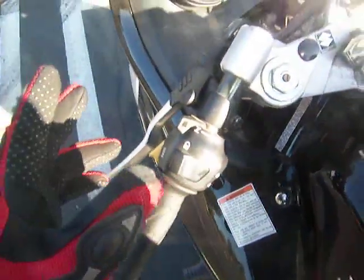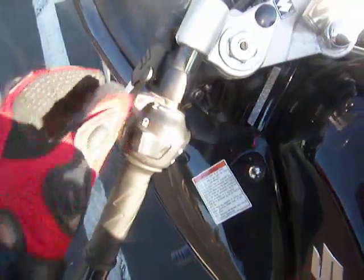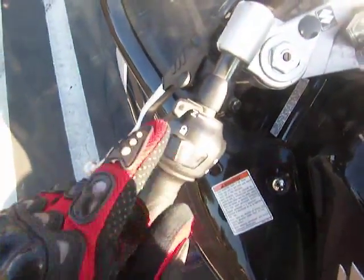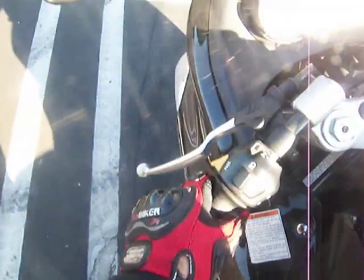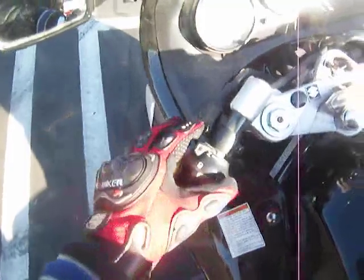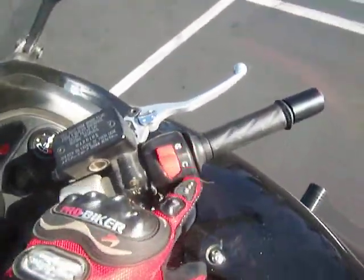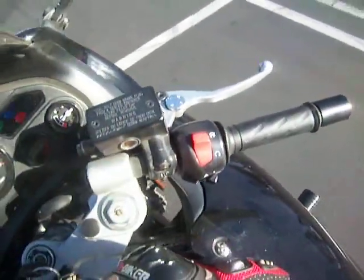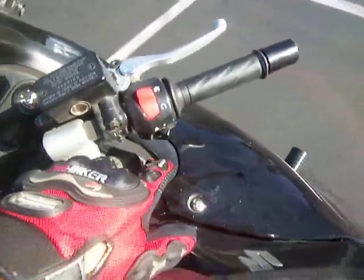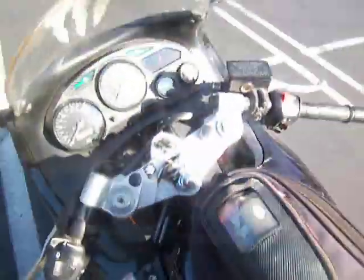The lights are always on on this motorcycle. And then, sort of like cars have daytime driving lights, these are the brights. If I want to turn the brights on, I click here. I can also pull this trigger if I need to pass someone and shine the brights on to get their attention, saying, hey, look, I'm passing, don't kill me. You've got the kill switch here. This stops all the electrical so that the motorcycle powers off. Hazard lights here. And I forgot, over here you've got the horn. Beep, beep, sounds like Roadrunner. Maybe we'll honk the horn.